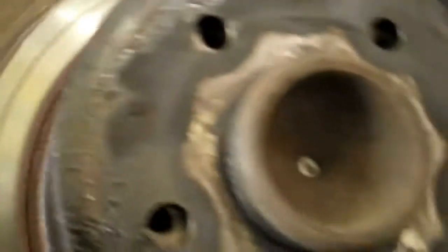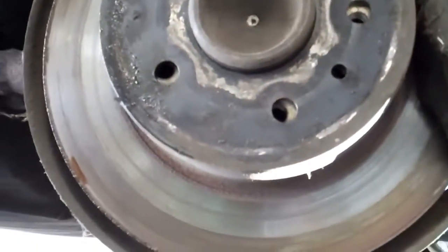Hello Terry, we got your 2EDSC up on the hoist and I just wanted to show you that the right rear wheel brake caliper is leaking brake fluid. These brake calipers go bad when the car sits a long time and they start to leak from the piston seals on the caliper. Basically you need to replace these rear calipers.